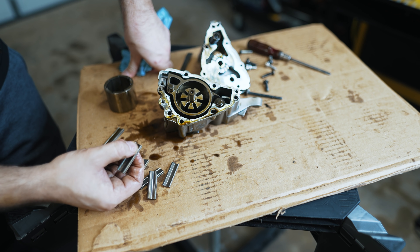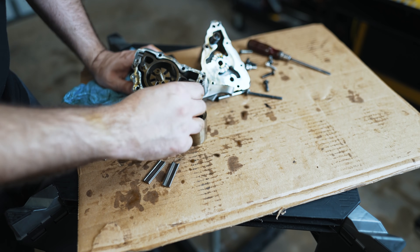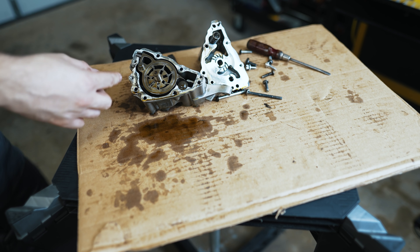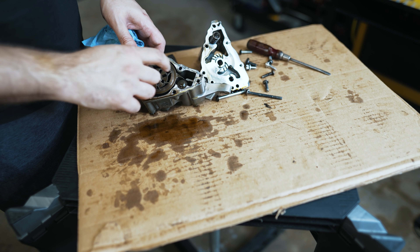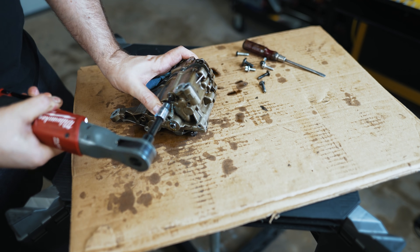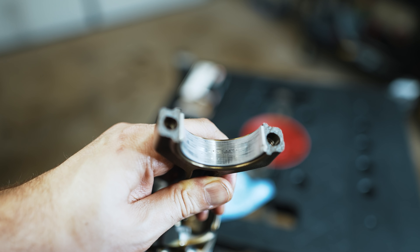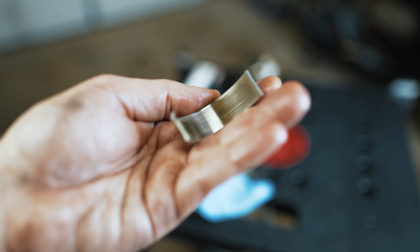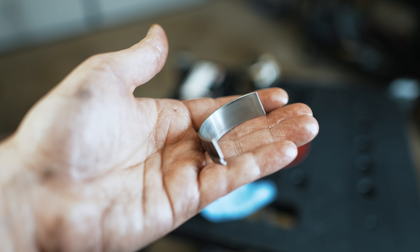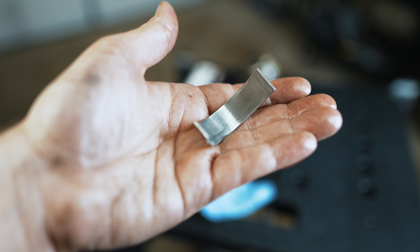These don't look terrible to me — there's a couple of score lines, but I don't see how that wouldn't be able to still build oil pressure. There's nothing obvious with the oil pump that would make it seem like it catastrophically failed; it was maintaining oil pressure for sure. Here's cylinder five after a thousand miles of the King bearings — pretty beat up. Here's my original bearing with 200,000 miles on it and even momentary loss of oil pressure — it looks pretty good, almost mint. There's the lower shell for cylinder five after 200,000 miles stock — it looks pretty good.